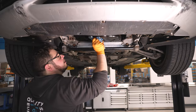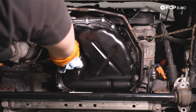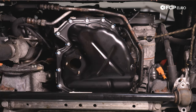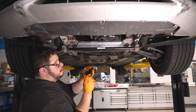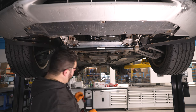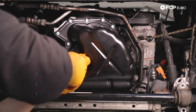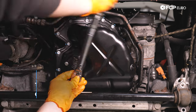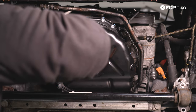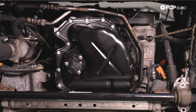We can also go ahead and install our new oil level sensor now that all the T30s are torqued down. I miscounted — I thought there were 20, there's only 19. We're going to feed our sensor in with our new seal. The sensor has a small channel in it for the seal — it just goes on, there's no right or wrong way. Just make sure the electrical connector is facing the right way. We have three new nuts — you can reuse your nuts, just make sure you torque them down to 10 Newton meters. You can go ahead and plug it back in while you're here.